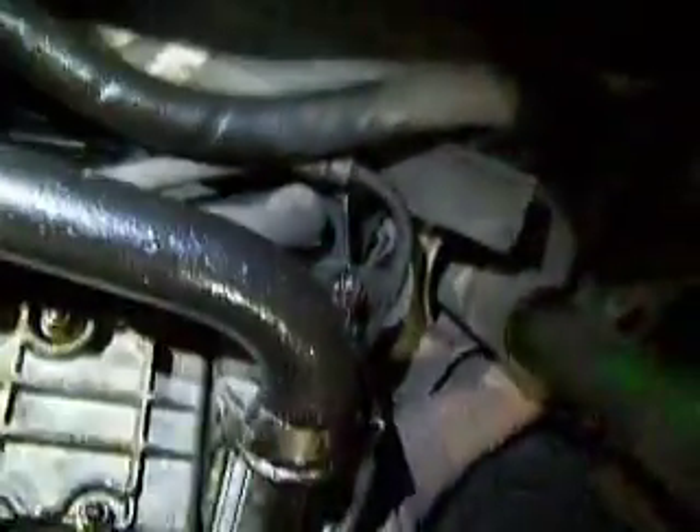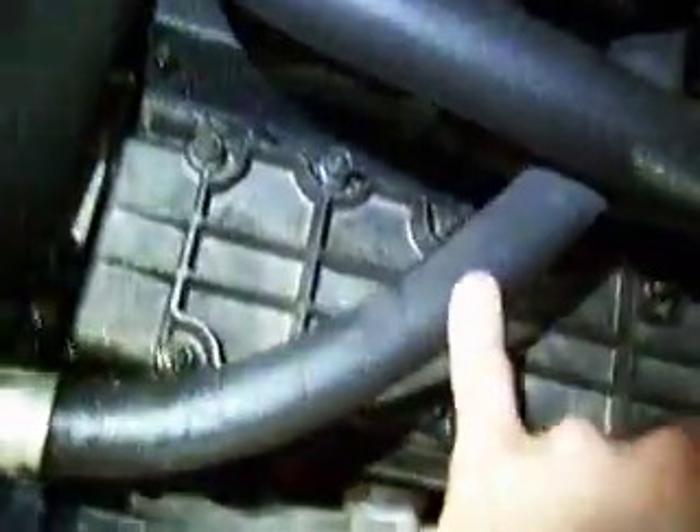Your S-hose here — you can see it's dripping down from this hose. I do believe it's leaking onto that one, so I don't think that one's leaking; this one is obviously leaking. We have a dry spot here, and then it gets wet right there — see the oil drops there. We can check that for tightness.